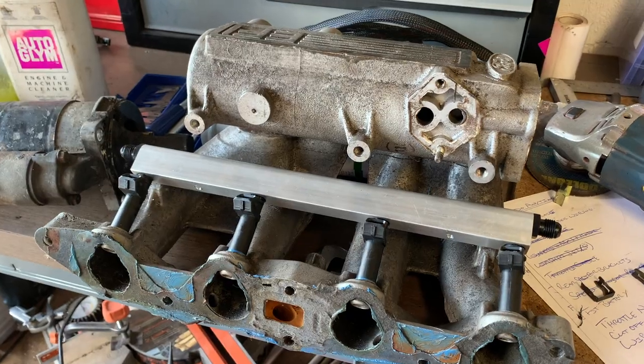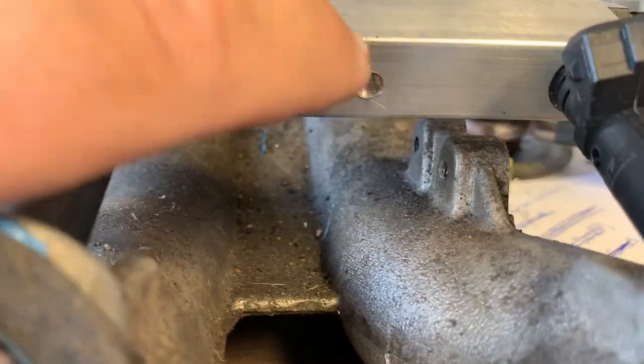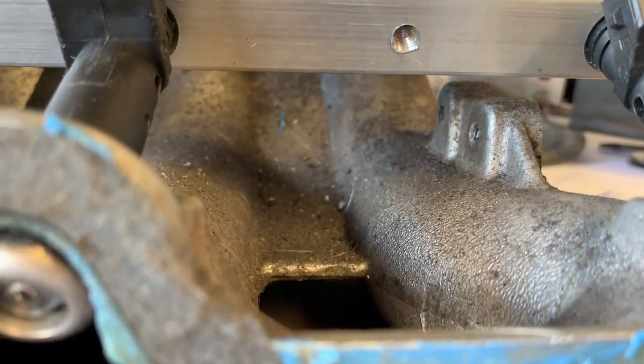I've chucked the rail into the old inlet manifold for mocking up purposes, and the rail wants to sit so it picks up from the mounting points — which actually sit further back than I was expecting. That's frustrating, but it shouldn't be too much of a problem. Change of plan on the unnecessarily complicated brackets — that hole lines up almost perfectly with the other one, and it's the same for the second side. So little straps down to the bolts that hold it to the head look like they're going to be the winners here.